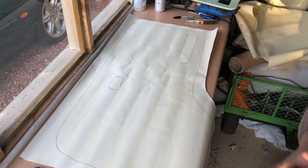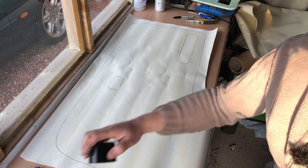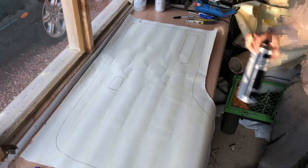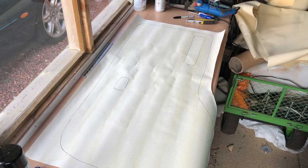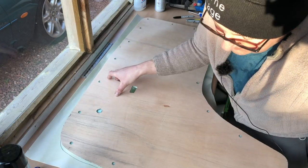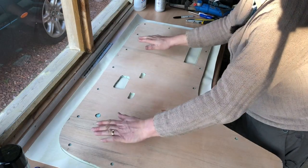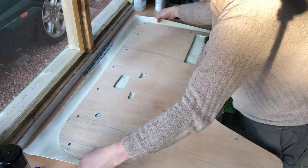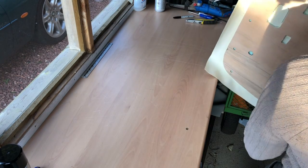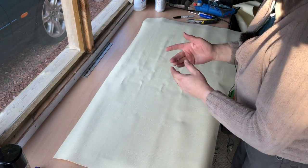After you've used your glue, turn it upside down and spray it until your propellant comes out, else next time, it'll be blocked. Then as soon as the glue's stopped being sticky, you can pop this onto that mark out that I did. Pat it so that the vinyl is attached, then flip it over, and smooth it out.